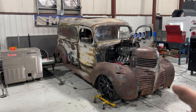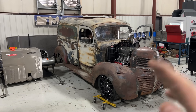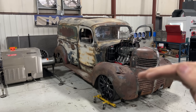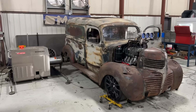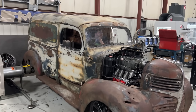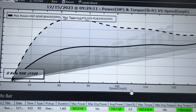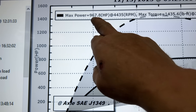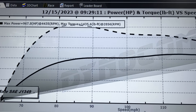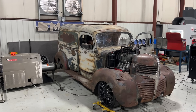So there was a funny deal where it idles and does everything at one RPM in neutral fine, but when you put it in gear it would lean out even though it's at the same RPM and basically the same MAP position. Had to turn on the closed loop compensation and let it pick up those funny little spots. First hit — disregard the RPM — but 967 horsepower, 1435 foot-pounds of torque. Now I'll go up and look at the tune and see what it was doing.